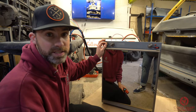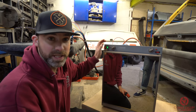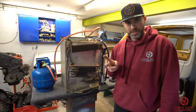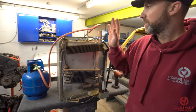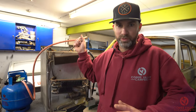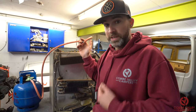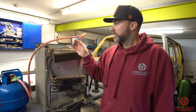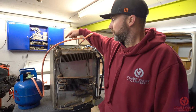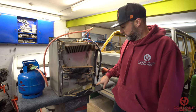What we're going to do now is unplug the 240 volt and do a test on gas — we'll show you the gas burner. We've tested on 12 volt DC and 240 volt AC. The last thing we're going to check is gas. Excuse the temporary setup — we wouldn't put it into a van like this in any way, shape or form. Again, in terms of safety, if you have any doubts about what you're doing, don't do it. Seek the advice of an expert or bring it to someone like us. All this is providing today is just an input of gas to feed through the valve down to the burner to see if we can get a flame.